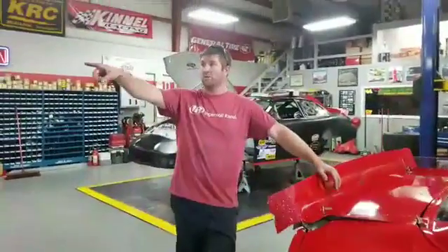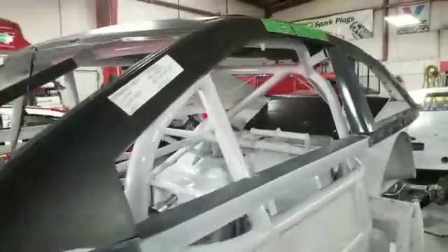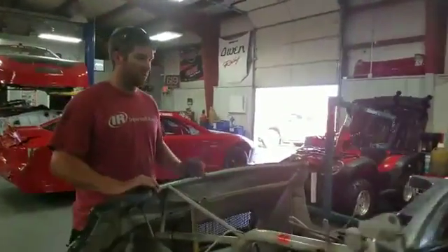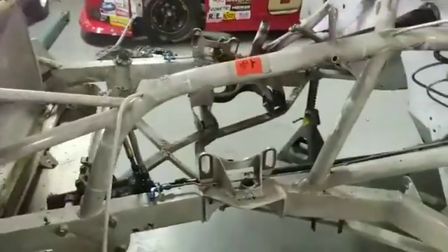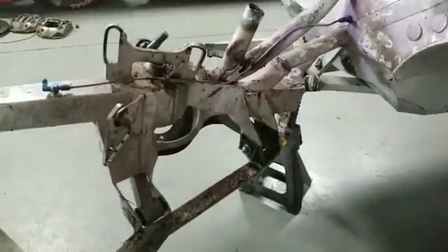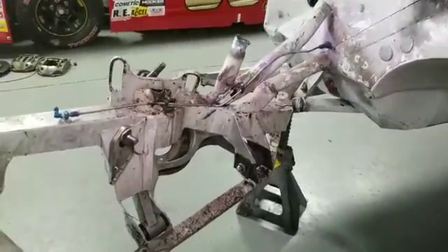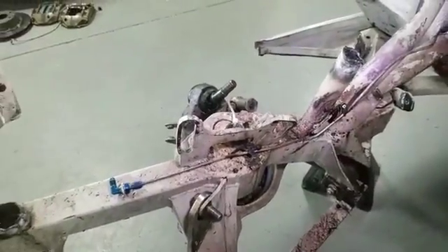You all just saw what's left in Nick's car. Did you see what's on this door — the name side, the driver's door? Right there where his name is. That's for Nick to look at. So after getting everything apart on the car, we ended up cutting the right front upper hoop off. That little box over there has got a pretty big dent, probably an inch at least. This whole right front frame rail is rolled up, and it's actually got the 1x2 box down here rolled up pretty hard. So this car is, by all rights, going to be junk. Unfortunately, it was a really good car.